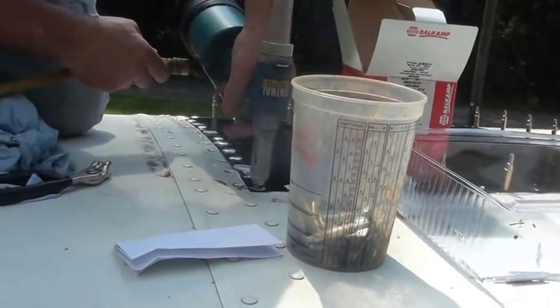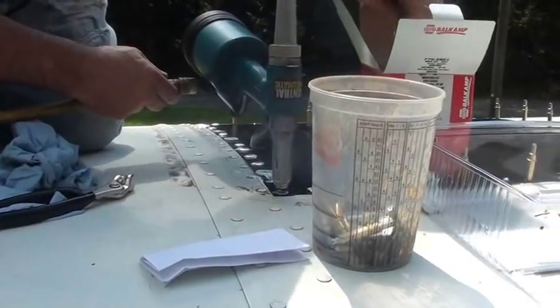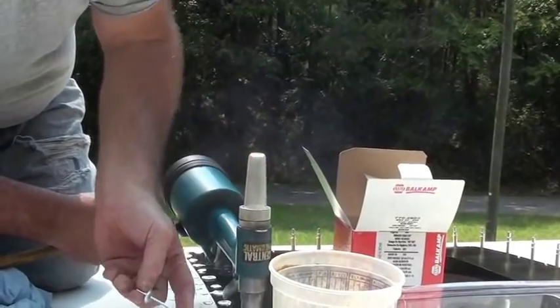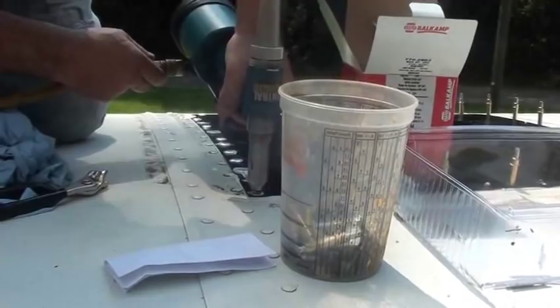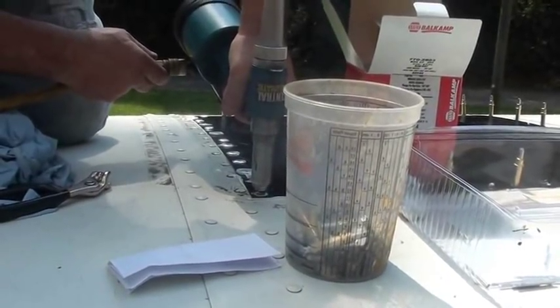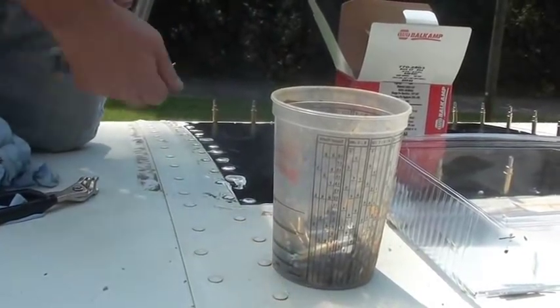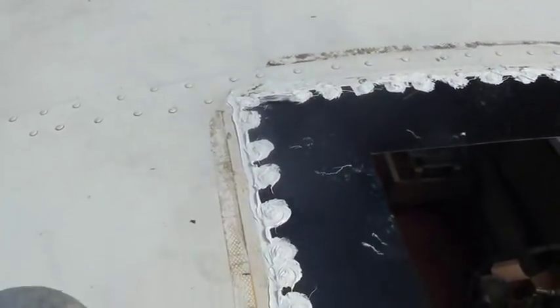What I'm going to do is pull this once. It's going to pull the stud — the metal pin — in here, but it's not going to pull it enough to bust it off. Then when you let go of it, the jaws will release and grab another bite. I got that all sealed up — 53 to 55 pop rivets in it, something like that.